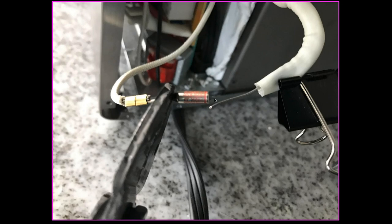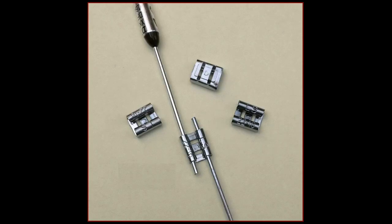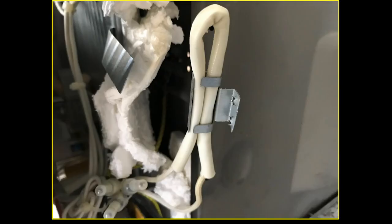Take the old fuse and use a wire cutter to snip just the fuse part out — you want the longer wire part to stay. Some people like to solder it in; I didn't want to do that. I just wanted to crimp it in, so I needed a longer end piece so I could crimp the new fuse in using crimp connectors. Then you put the insulation back on it, put it back into the bracket, adjust it a little bit if needed, and connect it to those two screws on the inner oven.